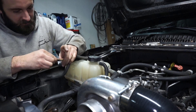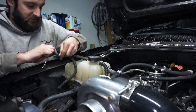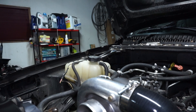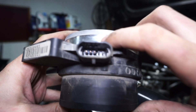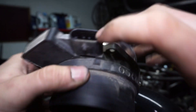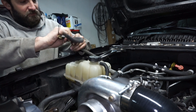There's a way you can check that besides looking at a wiring diagram — basically just look inside the MAF sensor and you can see where the intake air temperature sensor is inside of it, then reference where it is on the plug. You can see the little oval around those two pins — that's your thermistor. It's a resistance-based temperature sensor.